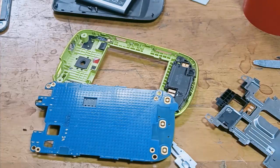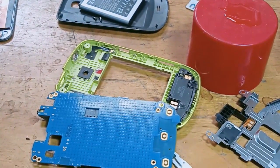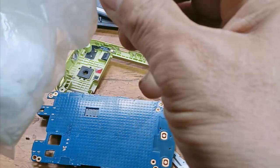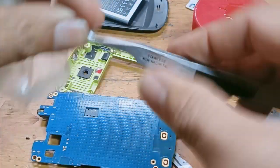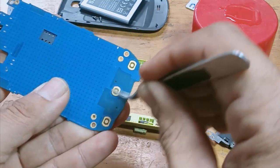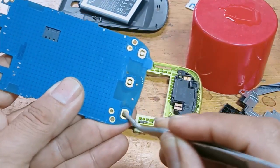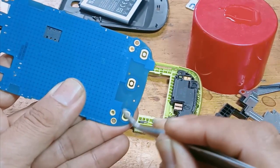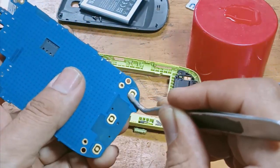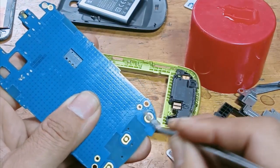To clean, if you have PCB cleaner at home that's best. Otherwise, use a little alcohol with cotton wool and clean the dirty key contacts. Scrub until they make contact again. I'm describing the case where the board is in good condition — no physical damage. Over time, the contacts lose conductivity. Scrub the copper pads until they are shiny and bright. If you don't have alcohol, use an eraser and rub it until it shines too.